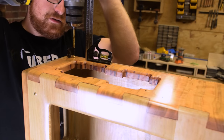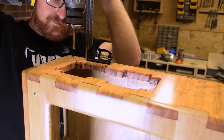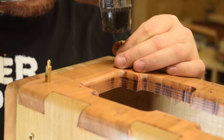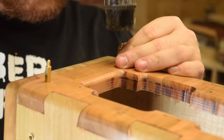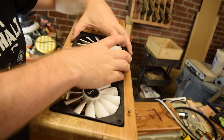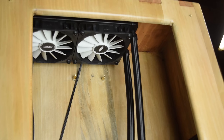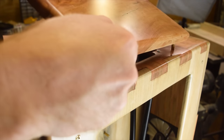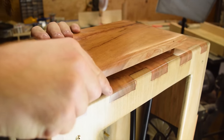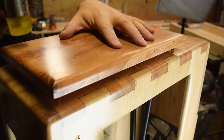One of the most terrifying parts: drilling holes into a fully finished case. I just needed to drill the mounting holes for all the brass hardware to mount the covers for where the fans were going to come out. I didn't want ugly fan covers showing, so I cut wooden pieces out of beautiful crotch cherry to cover them all up. To make it a little bit easier later, I went ahead and installed the fans and the radiator so I wouldn't have to mess with those later. The panels fit in with just a nice friction fit — if I ever needed to take them off they could totally come out, and if I ever wanted to really affix them I could put epoxy, but the friction fit is just fine.